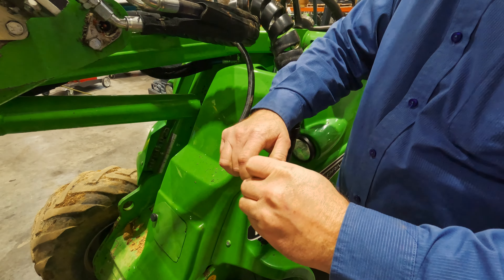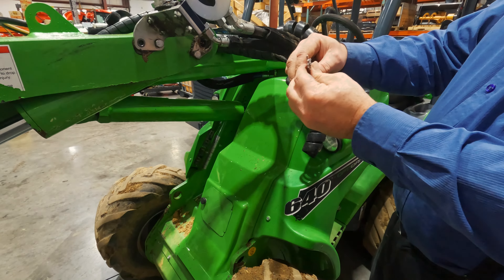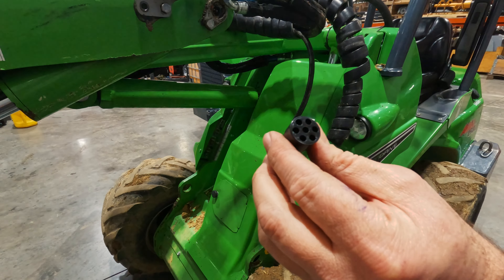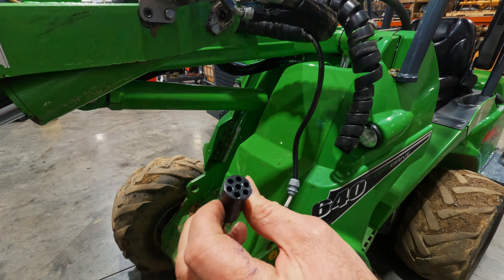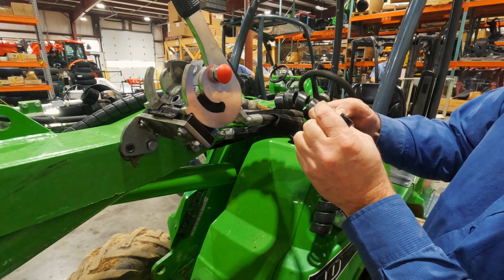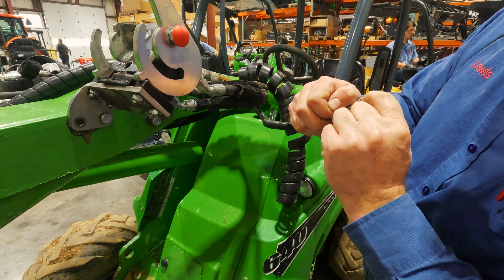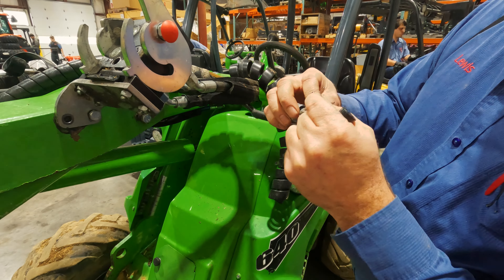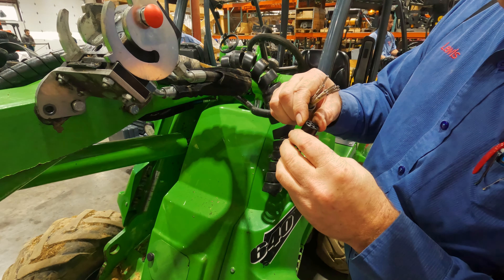You always want to make sure that you have your battery disconnect switch unplugged back by the machine, or you'll have sparks flying. So the idea of trimming that back is you have enough wire here so you can tell the numbers. The numbers are on this block — very hard to find; a magnifying glass makes it helpful. The green and yellow wire goes in the center.